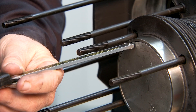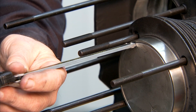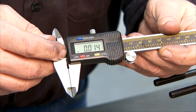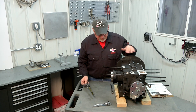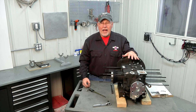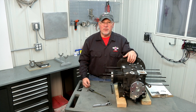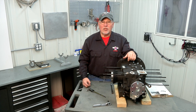Just make sure the caliper stays nice and square against the rim of the cylinder. If you look at our caliper here, it looks like we're right about at 14 thousandths of an inch — that's the deck height of this particular engine. Now we could do this on all four cylinders, and it really doesn't hurt to do all four individually. I have not yet come across an engine where the cylinders are not the same — they always come out within a half a thousandth or maybe a thousandth of an inch. But it doesn't hurt to check them all just to make sure.